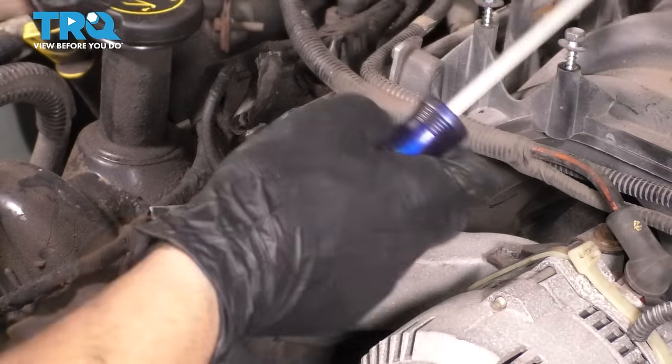Okay, perfect. We're on. I'm going to let go, but be very careful when you do this because you don't want it to jump timing. So hold it like this. Don't push the chain down because it'll slack off. This will fly, jump timing, and fly backwards.